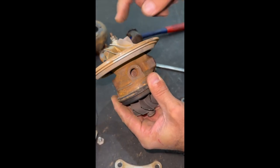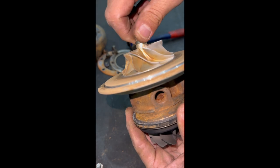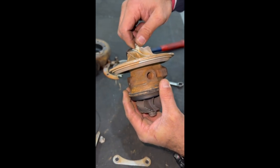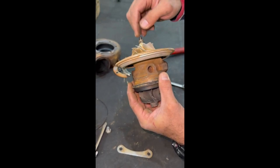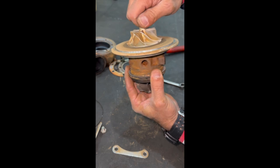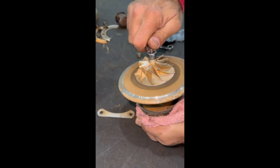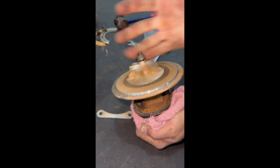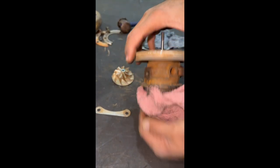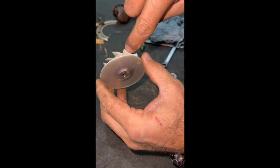You can clearly see there are some markings on the edge of those blades from the ingested sand and the side of the housing. I'm going to take this compressor wheel off so that I can show you where you should be looking to see where the actual impact damage occurs on a compressor wheel after being exposed to dust.